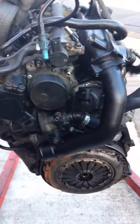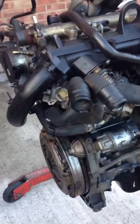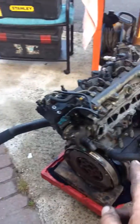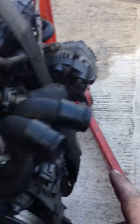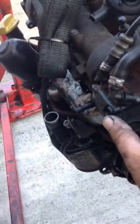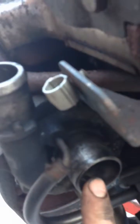Here's the engine - this is the engine that came with the red van. I bought two vans nearly back to back. Now this engine here was just literally a block. What I've replaced: I've replaced the EGR, that came off the old engine which I'll show you in a minute. Brake servo pump - that was replaced, that was missing. Fuel pump was fine. And the turbo - there's the turbo. I have tried it - that turbo is working okay, I've spun the fans around with the fins in there, that's working fine.